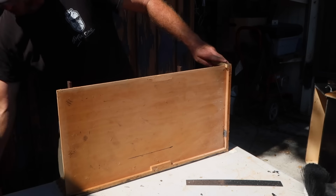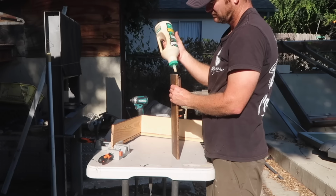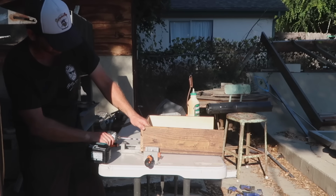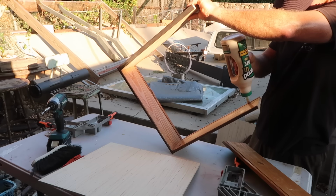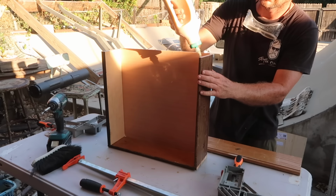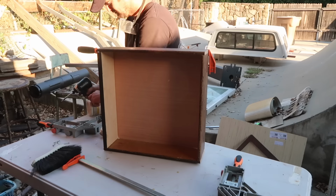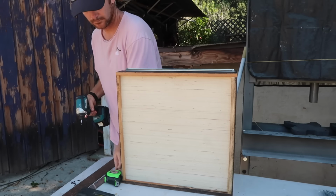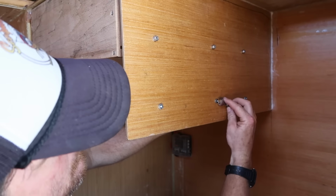Next, I wanted to have a couple of drawers under the sink. I ran out of scrap 3/8-inch plywood, so I grabbed a dresser I found dumped in a parking lot and reused the sides of the drawers to assemble boxes that fit my space. The sides are glued and screwed together, and they already have a groove cut into them that fit the 5mm plywood I was using as my drawer bottoms, so I just cut out the drawer bottom and glued it in place. I screwed the drawer slides onto the sides of the drawer and through bolted the drawer slides into the camper walls.